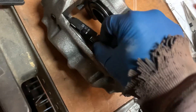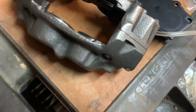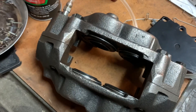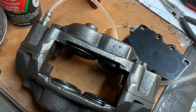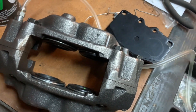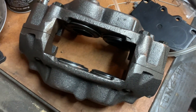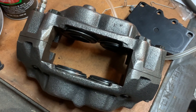We're going to put a little grease on these. Most of your parts stores will obviously give you a little grease to put on the back of these where your pistons hit - we'll rub a little on them and a little on the pins. This hose I've got hooked on here is just my bleeder hose; it was a little bit small. I'm going to try that other little trick I've seen on YouTube where instead of bleeding with somebody helping, you stick the line down in a bottle and keep it in fluid, then just pump the brakes until the fluid gets clear.